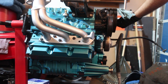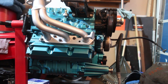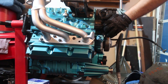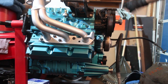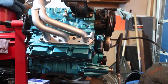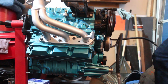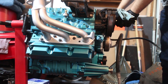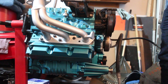Got the torque wrench set to 111 foot-pounds. It's going to rotate the engine here — basically this is just pressing the crank on since it's essentially hand tight. It did not hit 111 foot-pounds by the time the rotating assembly started going, so I got the pry bar in and got that torque down. Alright — 111 foot-pounds achieved.